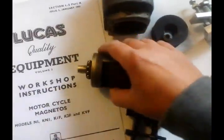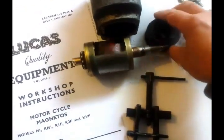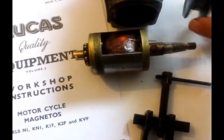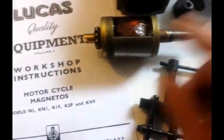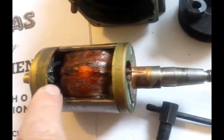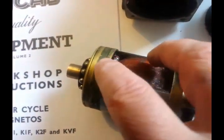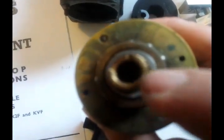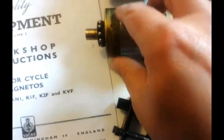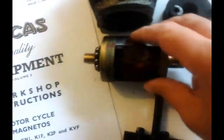You do have to be careful — there's a pin there, and that spike needs to touch down inside a little tiny hole. You do not want to bend that or damage it. Once you do get inside, all you need to do is disconnect that earth wire from that black box in there, which is the outside of the old capacitor. Essentially the capacitor will then have no earthing, and the live will continue to pass straight through to the contact breaker end. You're basically disconnecting the earth there so the capacitor is essentially out of parallel with the winding and rendered no use.